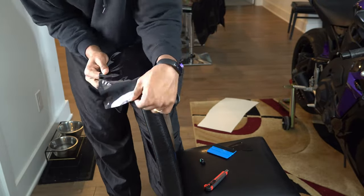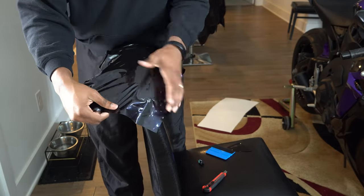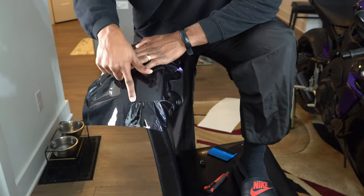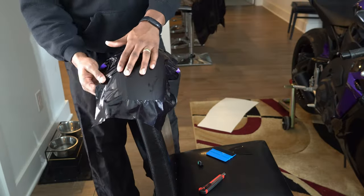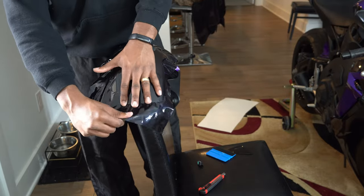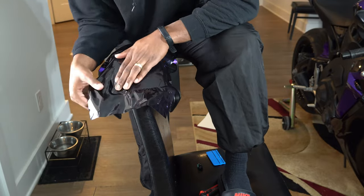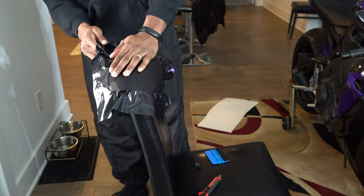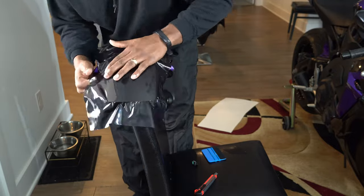Right here I'm just stretching the film, making sure everything goes nice and easy. There's not too much stress because I'm not using heat to overstretch it — just a little bit of elbow grease and being patient with the technique. This black is Avery Dennison. One of the things I like about Avery Dennison is it's just so easy to work with. KPMF isn't bad either, but Avery Dennison doesn't have too much tack, so you're never feeling like anything is permanent. You can see coming up that I actually have to lift a little bit of what I did, and it's just easy to lay it right back down.